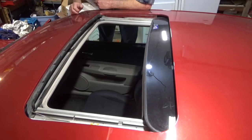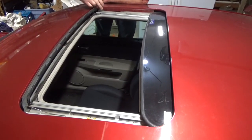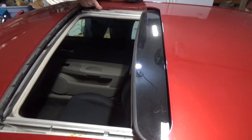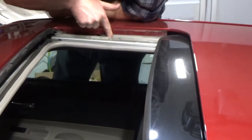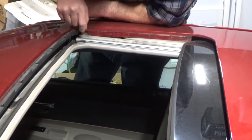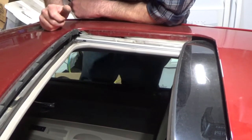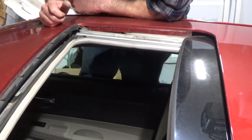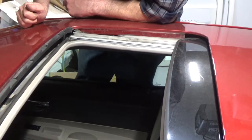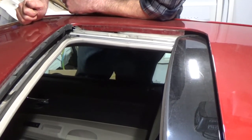So we'll go outside the car and take a look. To fix it, I went out from the top with the sunroof open and I put RTV between the car body and this aluminum frame, a little bit here and over here. What I was doing is just kind of making a shock absorber, kind of gluing it in place. Now it doesn't buzz anymore, it didn't cost anything to fix, and I didn't have to take anything apart.